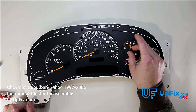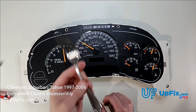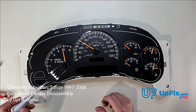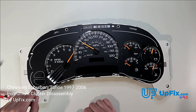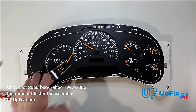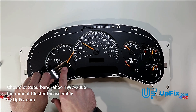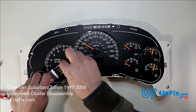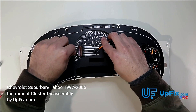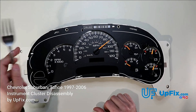You can see these gauges — this one sounds more shot. You can use a plastic trim removal tool or you can use a fork. You want to make sure that you're removing it safely. With older clusters, if it's been on there for a decade or longer, there's the potential of it breaking. I'm going to slide underneath right here and pry on it, but notice I'm not putting full force on it. You want to wait until the needle itself pries out. Put a little pressure on your wrist — you can see the needle here. We see a lot of needles coming in with broken stems because if you pry too quickly they can easily break. So give it some pressure, hold on to it so it doesn't pop off and fly. I like to grab it from underneath. If you're using a metal object like a fork, make sure you're not doing it over the LCD displays so you don't scratch anything. The last thing you want is a blemished faceplate.